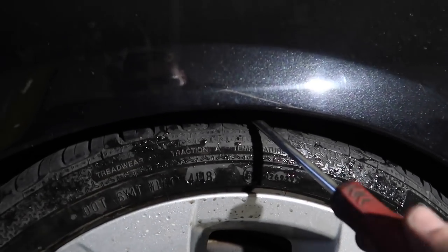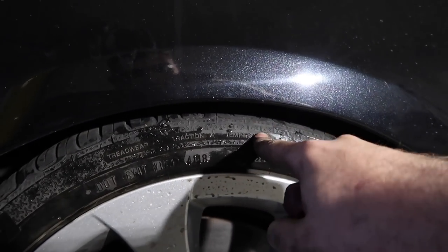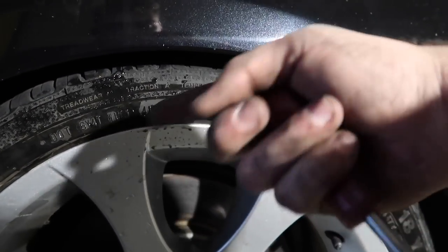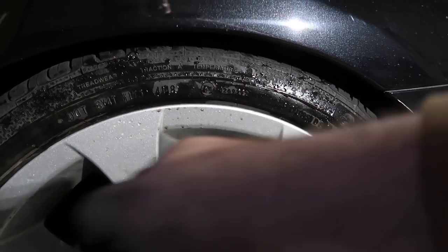Guys, this thing is low. I can't even bring my flathead to make it even. So if I'm actually gonna put spacers on the original ones and it brings it out more, I'm hoping it'll clear just perfectly. If not, we just have to take off the wheel and play a little bit with it. That's the cool thing about a coilover, obviously, is that you can adjust your height.